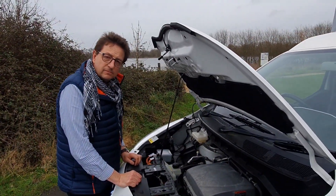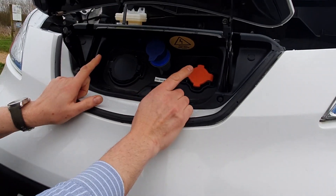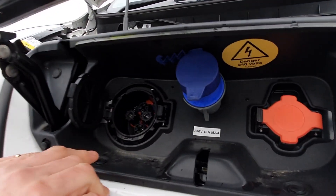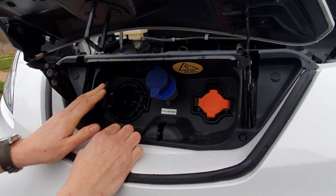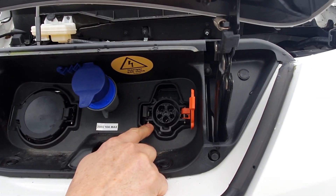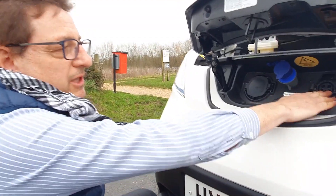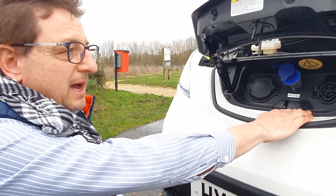And the charge ports that you mentioned earlier? The standard Nissan ENV200 comes with two charge points. You've got a fast charge point - if you turn up at motorway services or maybe IKEA, you can charge this thing from flat to 80% in 20 minutes. This other one is either a home charging port or for smaller sites and supermarkets, charging from flat to full in maybe seven to ten hours. At home we have a charger, and there's also another lead that will go into a 13 amp socket so you can turn up anywhere and plug it in overnight.